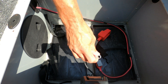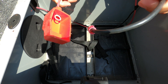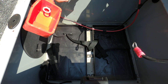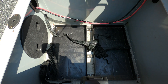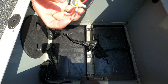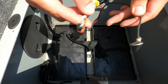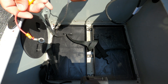Okay, so we have two wires coming in and these both go to your trolling motor receptacle. You have a positive and a negative, and these are the only two wires on most modern trolling motors that come in from your plug up to the bow back to the batteries. The other set of wires is going to be for your onboard charger. I have a two-bank charger, so you're going to need a positive lead and a negative lead on each battery — bank one positive and negative on battery one, bank two positive and negative on battery two. Very simple.